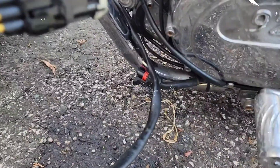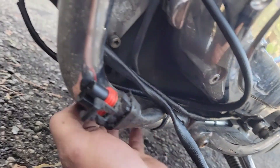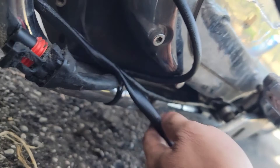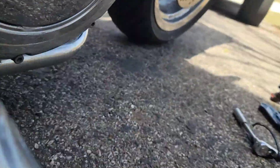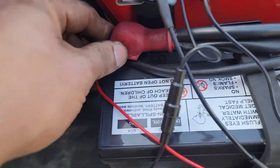So I'm going to pull everything together. Connect the stator to the rectifier. Put the wires here. The ground I put here. Hopefully it works. It's long enough to run all the way over here. Here's the fuse with it. Then plug it in.